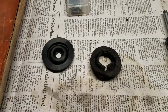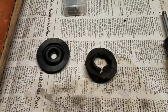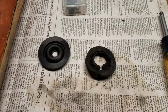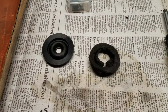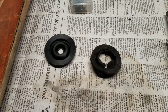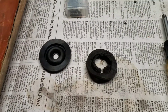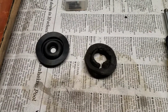It's got a weird screw bolt thing on it that has threads on it, but they don't do anything. It actually has a little pin on the end, and it has a clip that goes over it that snaps into place. So if you're trying to figure out how to get the throttle pedal off, it's a ton of fun. You got to get your head down in there to even see the clip, and then pry it off to get the bolt out that holds the pedal on. Tons of fun. Best if the seat's out of the car, of course.